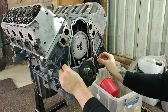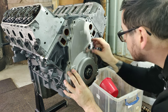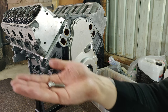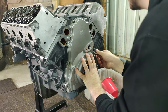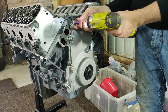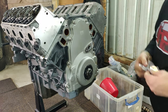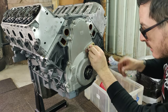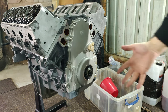Get the front plate on — we won't be torquing this down now because it gets centred up by the crank pulley, so we'll get that done another time, probably off camera. This strangely didn't come with any hardware despite being made by the same people that made the rear one, so I bought some nice titanium bolts — they were literally about 20p more expensive than stainless steel, so why not? Probably the fanciest bit on this engine apart from the ARP studs. Just winding these in with the gun, not getting them too tight. The final touch is the cam position sensor, which just slots in and gets a little bolt. Doesn't that look awesome? It's a shame it's going to get covered up by a water pump, pulley, belts, and pipes.